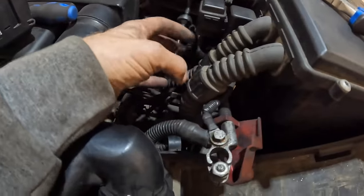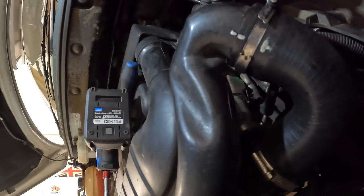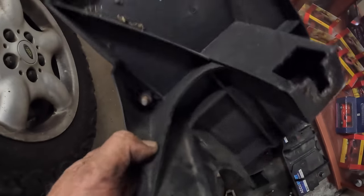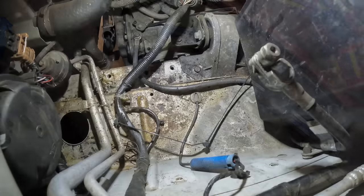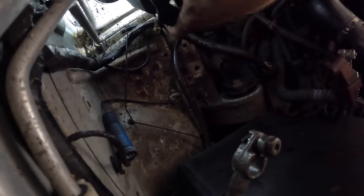This battery is really not going anywhere - there's literally always something. I've just undone the plastic clamp that holds the big cable harness to the back of the tray, and just found another little clip here. You can see why it's cable-tied in - this bracket is snapped off. This is the complete battery bracket that will hold it in place, but it's a captive nut situation and it would not undo. I changed the entire tray. I'll give it a good clean up, some silver hammerite or rust preventative paint, and fill the cavity in the chassis rail with wax too.